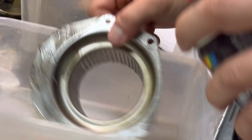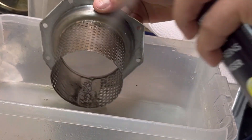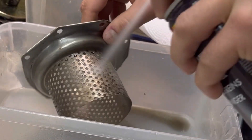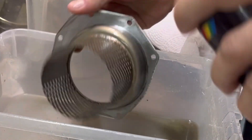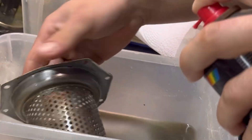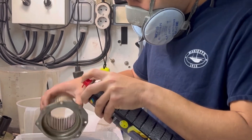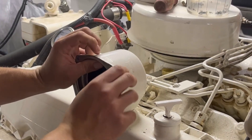So what are we doing today Matt? We're going to take this perfectly good working engine and make it not that. Matt and I followed the workshop manual going through the maintenance schedule, ticking all the boxes off. First step was obviously the PCV valve — you can see us cleaning it here with some brake cleaner, removing any oil. There was quite a decent amount of oil in the filter due to too much crankcase pressure, which needed to be cleaned.